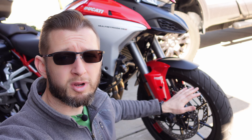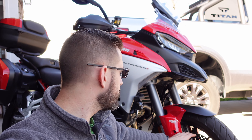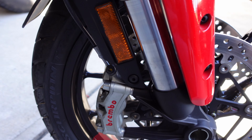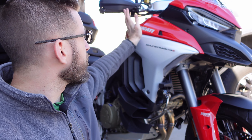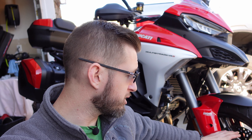Probably an even bigger notable change from the 17-inch wheel is braking on the front end. The rotors are the same size as the old bike — 330mm — right between the 320 and 340mm MotoGP runs in wet and dry. The front calipers are Brembo Stylema, a variation of the M50s from the old bike — the latest and greatest from Brembo. The problem is the bigger wheel means the brakes don't bite quite as sharply. Braking is still very good, but the front lever feel isn't as crisp.